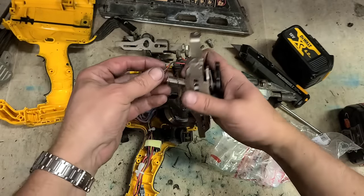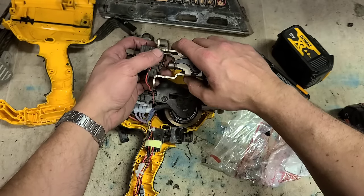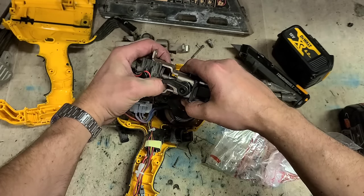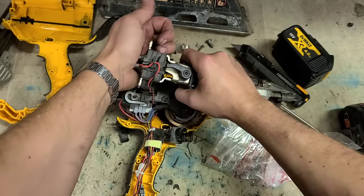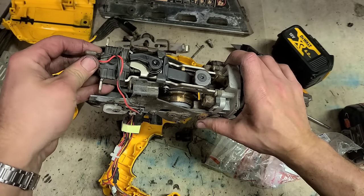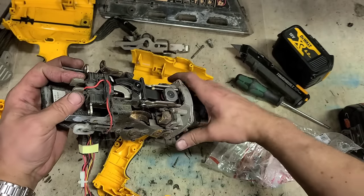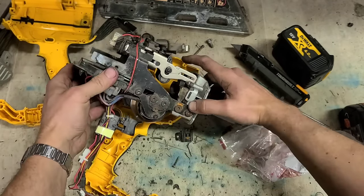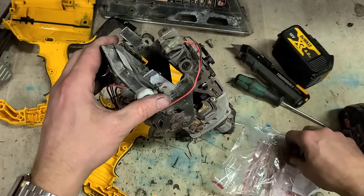First thing, put your spring on your plunger. And line up the solenoid. You have to get the plunger lined up to the hole. Get that on first, and then push your solenoid on the whole way. And the front bits locate up under here. Lift up the back, slide it forward. Can be a wee bit finickety to get that on, but a wee bit of wiggling and jiggling, it will eventually go on.